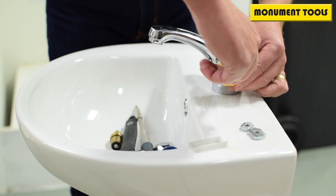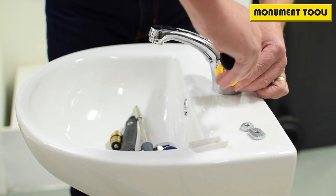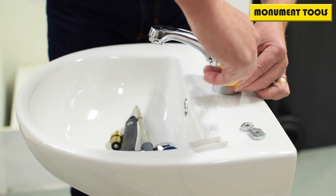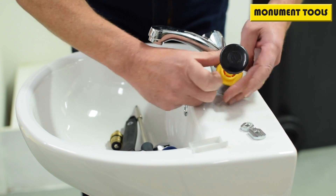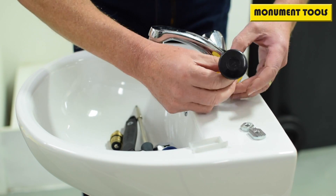The bush now ensures that the cutter is perpendicular to the brass seat that we want to cut. Then applying light pressure, we can now reseat the brass and take that back out.